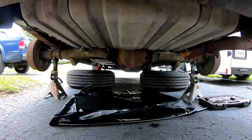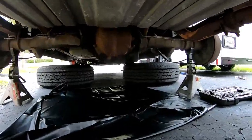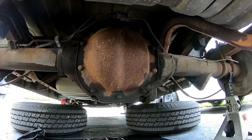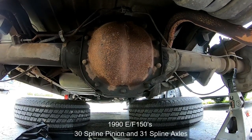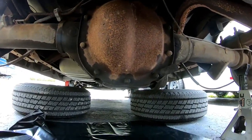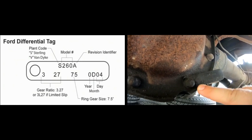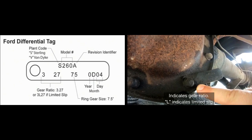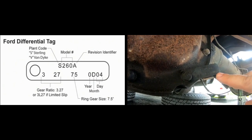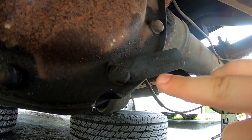What we're working with here is a Ford 8.8 — that means the ring gear is 8.8 inches. I believe it's a 30-spline pinion and the axle shafts are 31 spline — don't quote me on that. On most Ford rear ends you'll have a tag: this '3L55' means 3.55 gearing, the 'L' indicates limited slip, and '88' is the year of manufacture. The tag also gives you a date and week code.